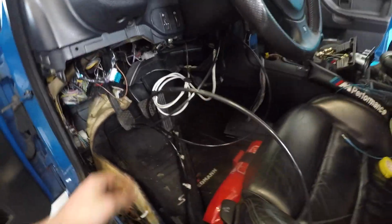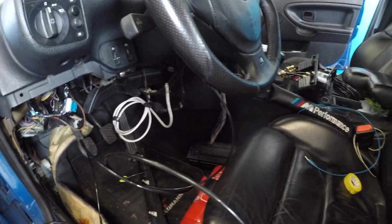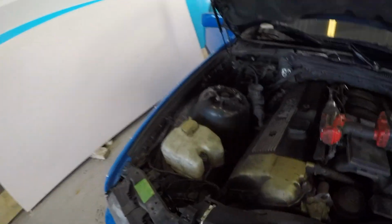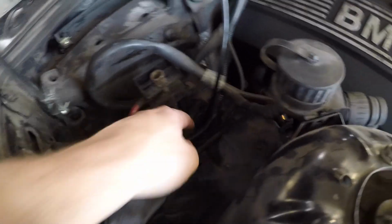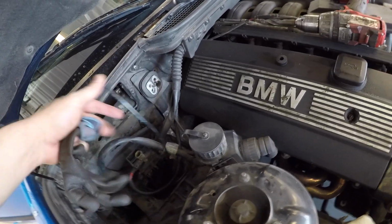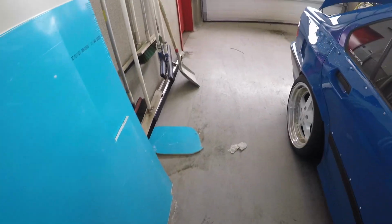So the pipes for the rear go through here and up into the dash, and then to the front airbags we have a pipe through the firewall underneath the glove box, and it comes out with the positive cable down there, up here. Then we'll put a T here, one to this bag and one to the other side, and then there's a hose that comes here, and there's a T to this bag and then to the other.